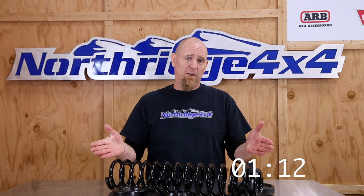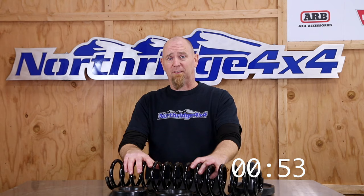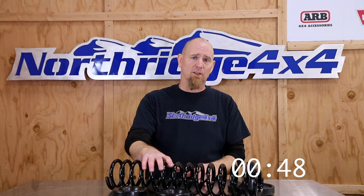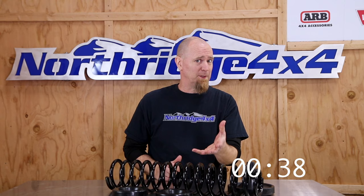Now what's the other big difference between the two? That's going to be performance. With a spacer, all we're doing is lifting — it's just a spacer. We're lifting the suspension or the chassis higher by putting the space between the spring and the chassis. With a spring lift, because we're replacing so many more components — brand new springs, a heavier spring rate, and usually a better shock, along with geometry brackets — you're going to get a better performing suspension.